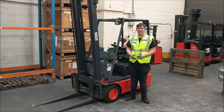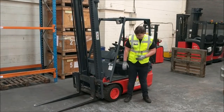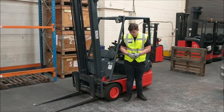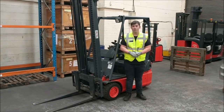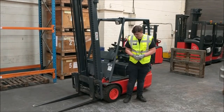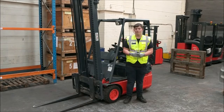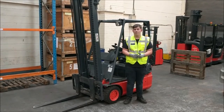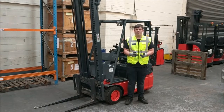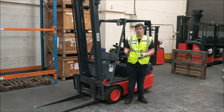Up next, we can take a look at our wheels and our tyres. First, we'll take a look at our wheels, ensuring that the rim has no damage that's going to affect the way the truck moves. Also, that our centre plate is nice and flat and all our retaining nuts are present. Next, we can take a look at our tyre — ensure that there's no excessive chunking around the edges and nothing's stuck inside. If there is any debris stuck inside, attempt to remove that yourself. If that's not possible, then try to get someone more competent to do that.